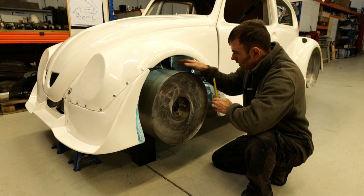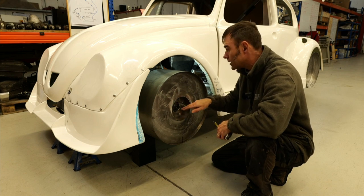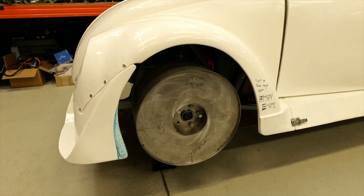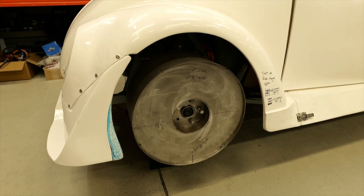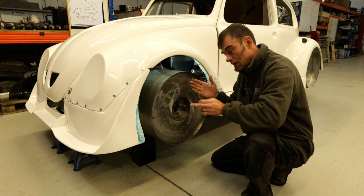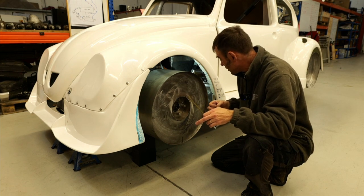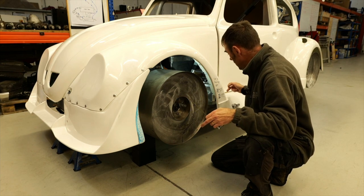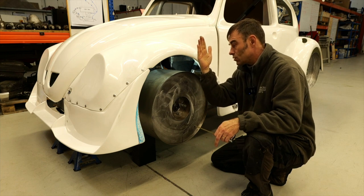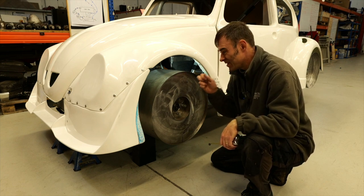So clearance there, clearance on the inside, but equally the calipers - they stick out quite some way so the offset is quite large, which I'm a little bit worried about. We're juggling about three different parameters at the same time to get the optimum size wheel for the traction we need, and we also have to consider steering lock. These wheels are quite a bit wider than the original wheels on this car. I think we're going to end up cutting and shutting the fibreglass wing to bring the surface out a bit further so it encapsulates the wheel and tyre. More on that in future episodes. Rears are done, fronts are problematic.